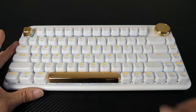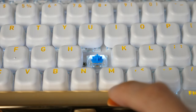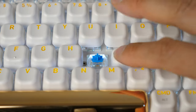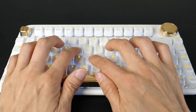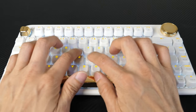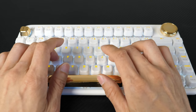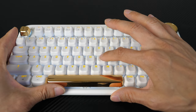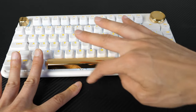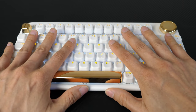I did not get to pick what kind of mechanical keys these are, so I'm going to pull one off — it's a little hard to pull off — and you can see that it's blue. These are mechanical blue key switches. If I press it, you can hear an audible click as you push down on it, and you can also feel a little detent underneath. It's like a little bit of resistance as you push the key down. This keyboard comes with blues only and you don't really get a choice.